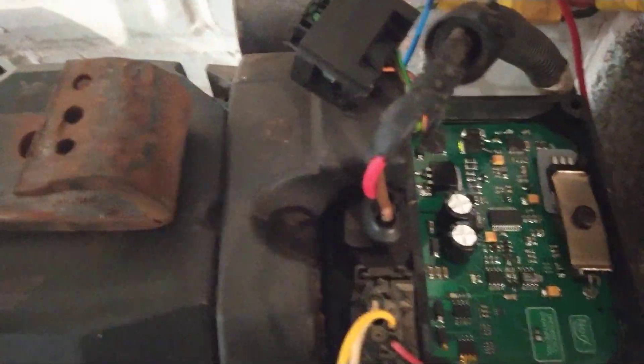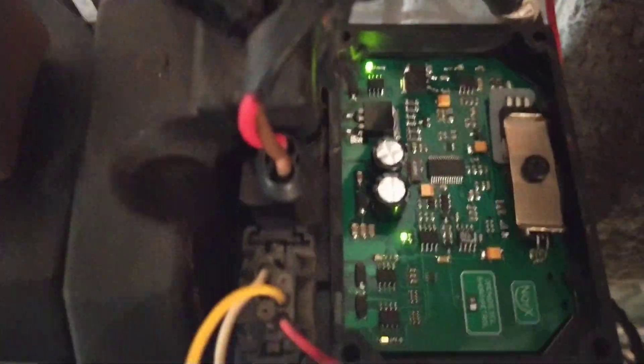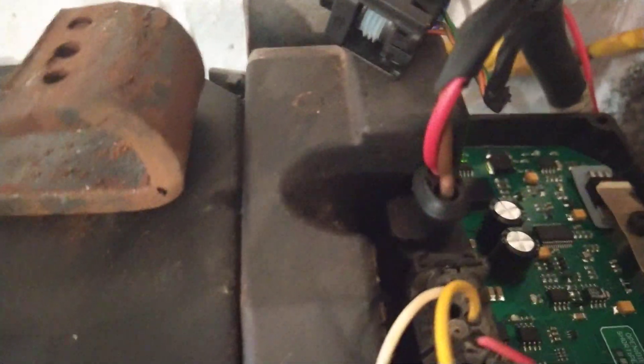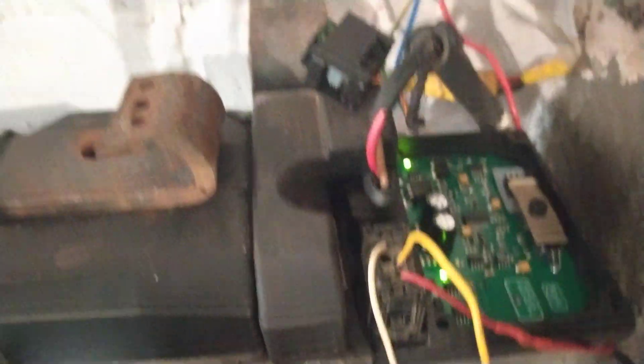What I've done is I've put this aftermarket unit in. It just cuts all the confusion, all the problems of wiring. If you get one of these then it's as simple as cake. With this one, pin one is the controller, which is that white one there. That one there, the red one, is your switch output which goes to your fuel pump. This yellow one that's cut here — that's the control of the fan that comes on at about 40 degrees centigrade.